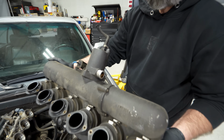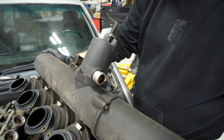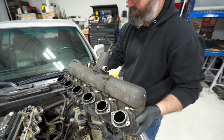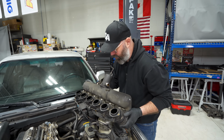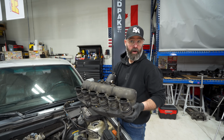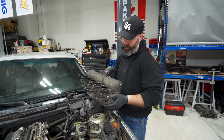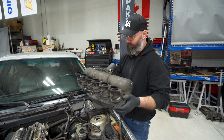And first we were like, is that part of like an evap, charcoal? But no, it's a catch can. They've integrated what appears to be a catch can that actually recirculates back into the oil pan off the bottom of the plenum here, which I think is pretty brilliant because it keeps oily vapors out of your intake system. So kudos to BMW on that.